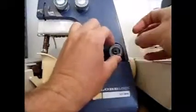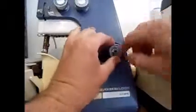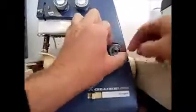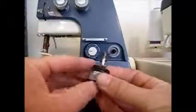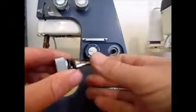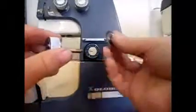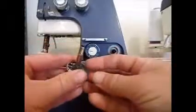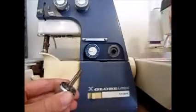Slightly to the right, clip in, and when you tighten it, you turn it in, and your 9 should be exactly in the same spot again. So we turn all of this out, then this whole unit will pull out, and two tension discs. Then you have another little washer just over here that fits in first.